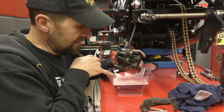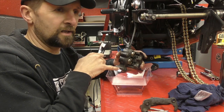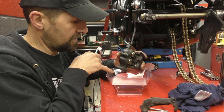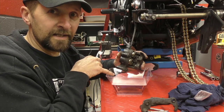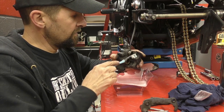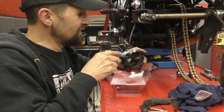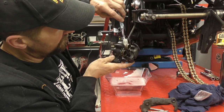Long-term consistent care of your brakes will prevent you ever having to rebuild a caliper if you get it early enough. For cleaning, I'm using an old toothbrush and washing liquid for clothes — the stuff that goes in the washing machine. Not dishwashing liquid, which contains a tiny bit of salt. Not car washing soap either, which contains wax. And importantly, no conditioner, because that's silicone-based and will cause slipperiness on the brakes.